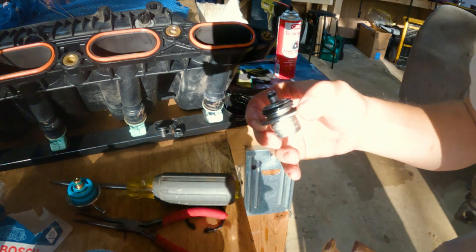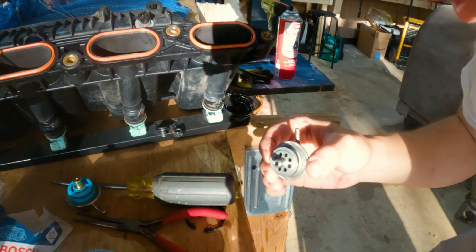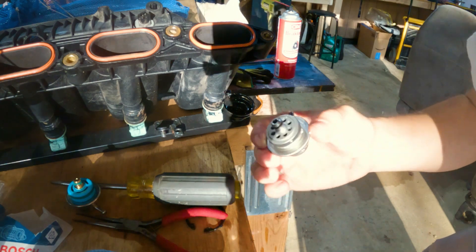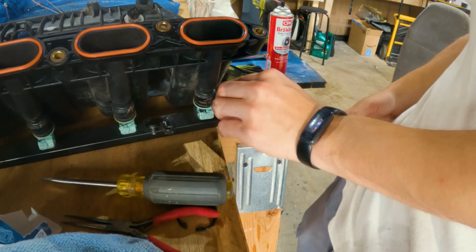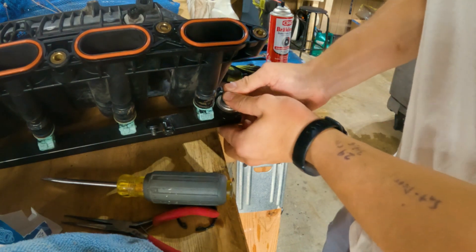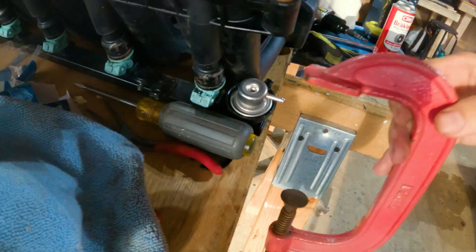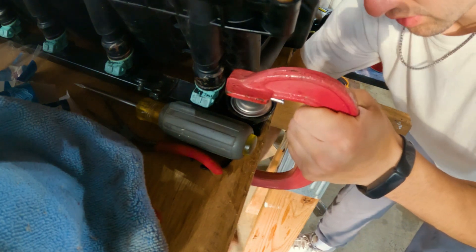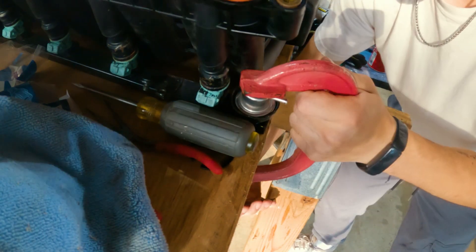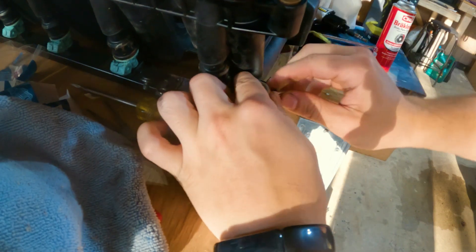Sometimes you can see a crack on the diaphragm, but I don't see one. My guess is it's messed up on the inside. Clean this up a little and the new one should pop right in with a little bit of force. I'm going to use a clamp tool in my garage to press it in slowly — hopefully nothing gets damaged. Okay, it's going in — and I think that's in.